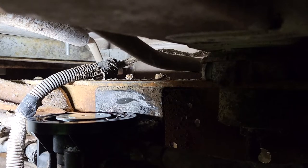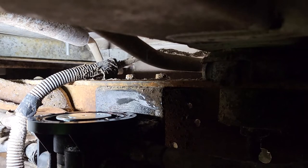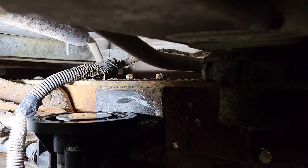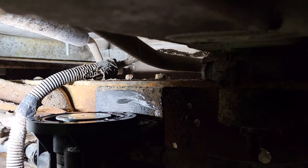So this was down, the rubber side was down. That's why it was hard to come off. The rubber was stuck to the... And then you got this here, and it's all clean. So, there's B on here. I wonder if B stands for bottom. Yep. Okay. The metal goes up. Yeah, metal's on top, but the diaphragm itself has B on one side and nothing on the other side. I want to say that the B was facing in. I should have paid more attention, dang it. Well, the metal was up. I know. That goes on here. That's correct. Metal on top, B for bottom.